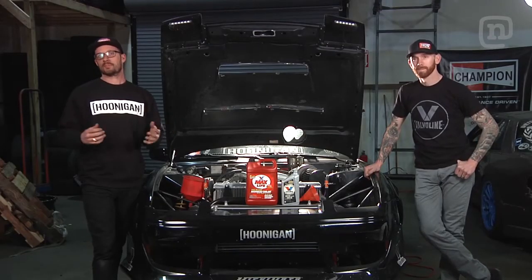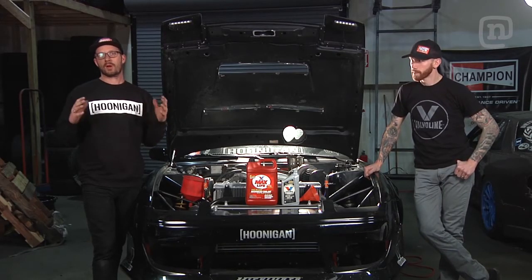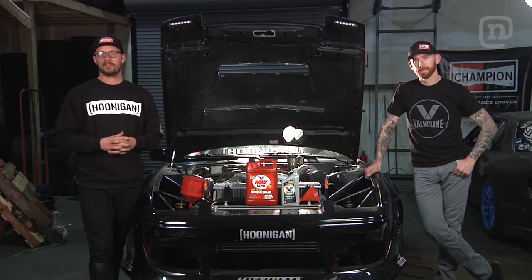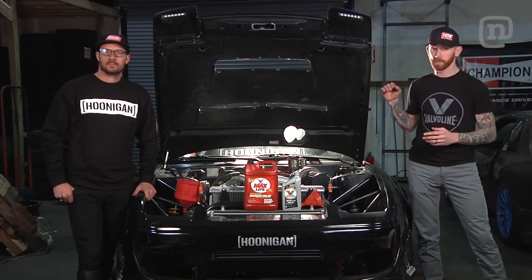This isn't a break and fix, this is preventing a break and fix. You're running your car all day on the track, it's running hot, it's going to create some air bubbles. You're going to want to check the fluid level in the radiator, put some coolant in and re-bleed the system if it's low. The oil is the lifeblood of your engine so you're going to want to make sure that is fresh for every track event. And you can even check your filter to see if there's any debris indicating premature engine failure.